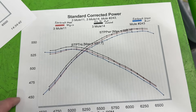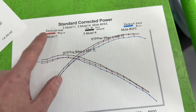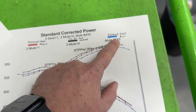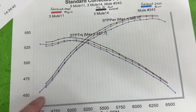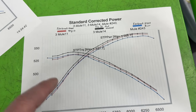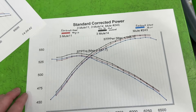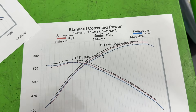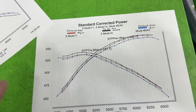Focus more on getting the better manifold. Here, the only thing that's changed is the black line is the Victor Jr. manifold, the red line is the 40-grit finish, the blue line is the burr finish — both on the Edelbrock Super Victor. If you notice, the Victor Jr. beats both of them no matter what the finish is. The point being: if you just focus on surface finish and not on the actual design of the manifold, you leave so much more behind. The better manifold will make more power and torque whether you burr finish the other one or not.